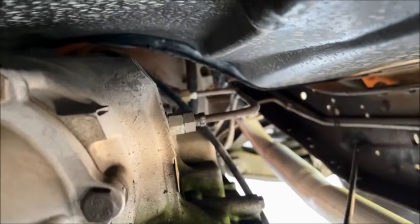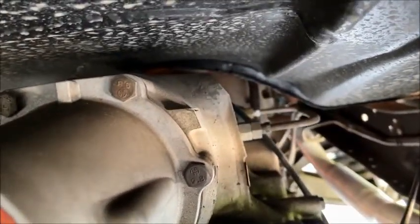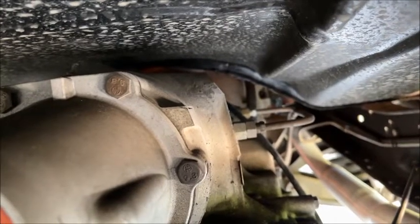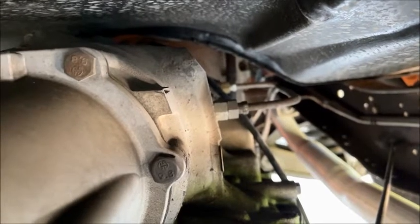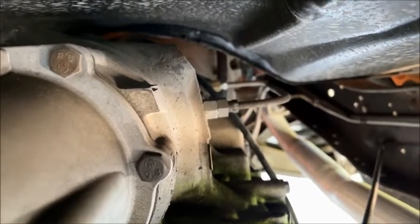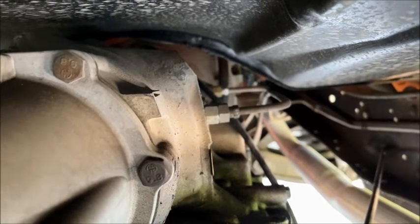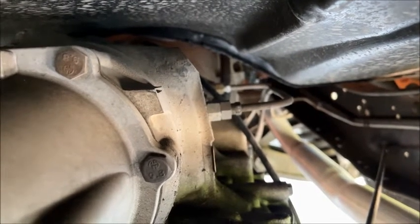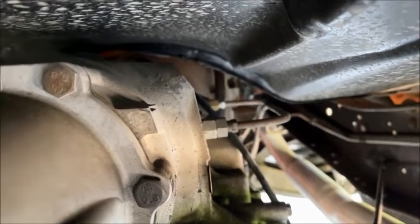It also clears your cooling lines. You'll notice those are threaded 5/16ths. This transmission is actually a 2001 model out of a Chevy Express van with a 5.7 L31, the old school small block Chevy. Around 1996 or '97 they changed those screw-in fittings to a 3/8 slip-fit coupling. You probably just want to get rid of those and go back to the old style 5/16ths threaded flare fitting.